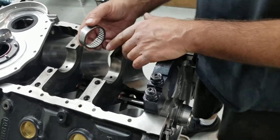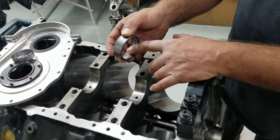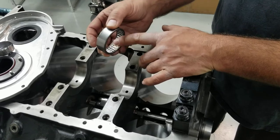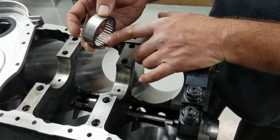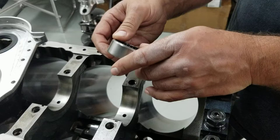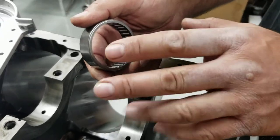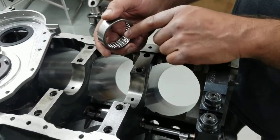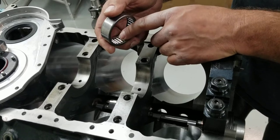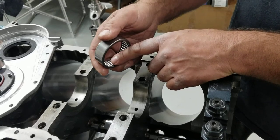What we've stumbled into as the years roll on is that imports are coming in and companies like SKF or Timken — or companies that may have been bought out — have changed the design a little bit. We try to find, which is fairly obsolete, what's considered a Timken bearing with a German insignia on it — it says Germany right on here. Getting rare, getting tough to find. The difference is these needles are highly polished in this rollerized bearing, whereas the ones from China, you won't even remotely come close to that polish.